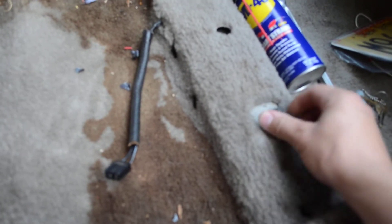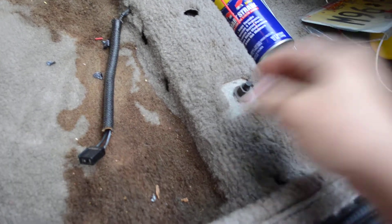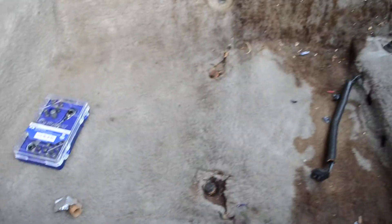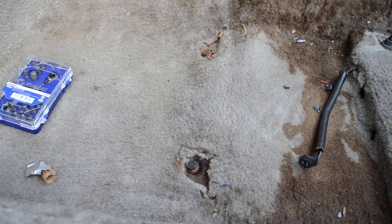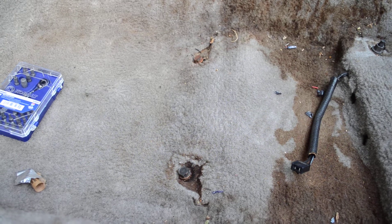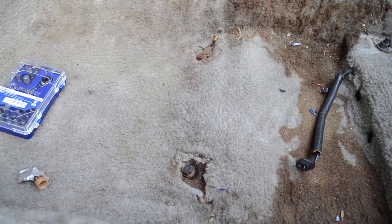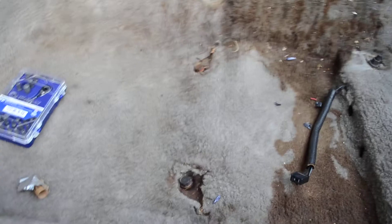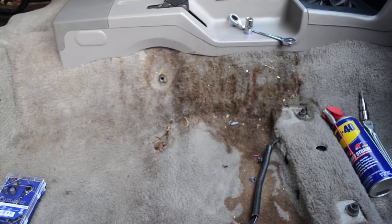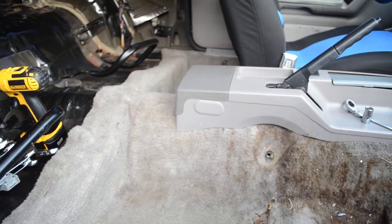You could see there's two little wing nuts here in the front, two nuts here in the front where the screws come up this way, and then there's bolts that go down through the floor. These are the two bolts — when I'm doing the subframe connectors, the two rear seat bolts are going to be a connection point. So the reason I put these back in is because after I take this carpet out I'm going to get my subframe connectors welded in by a professional shop.